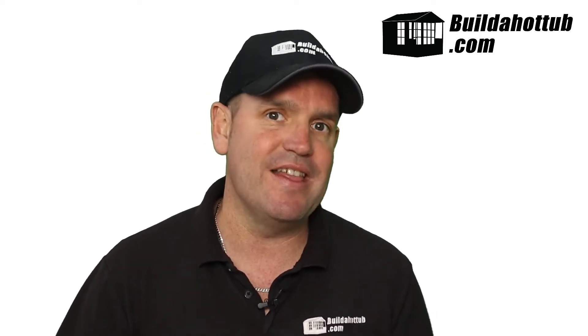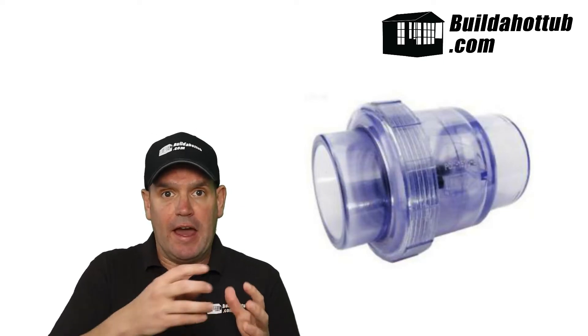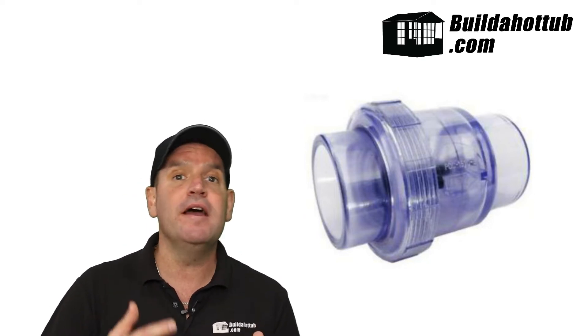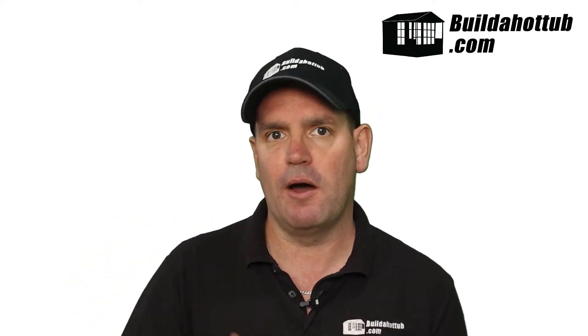But before we do that, we've got to think: how did water get in there in the first place? Somewhere on your blower lines will be a check valve — a one-way valve. When the blower is running, it forces the valve open to allow airflow through. When the blower stops, it closes up. The idea of this check valve is to keep water out of the system. However, over time the rubber seals can break down, or more commonly, you can get a buildup of dirt and particles that stop the valve from closing properly. When that happens, water in those lines will pass through into the blower. Changing the check valve often solves the problem, and on plastic shell tubs that isn't a problem at all — you can change it and it will be just fine.